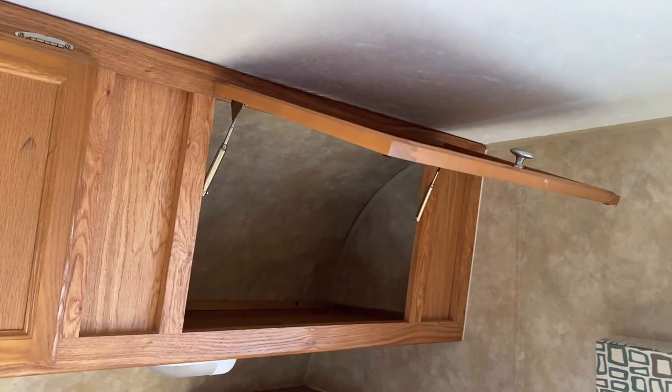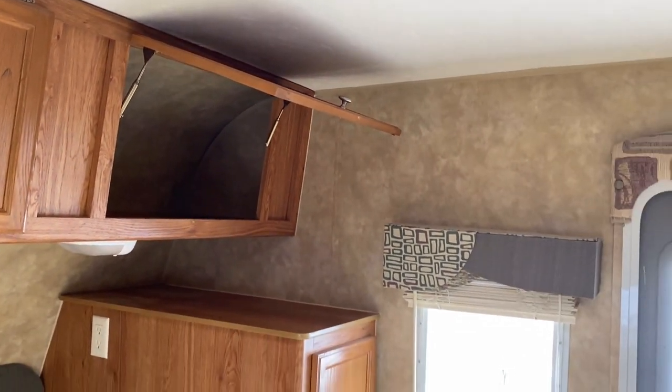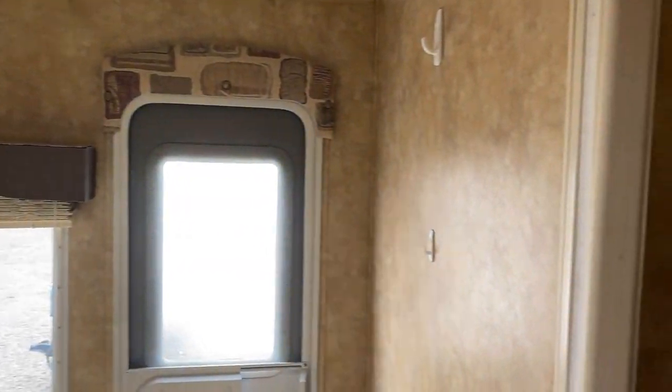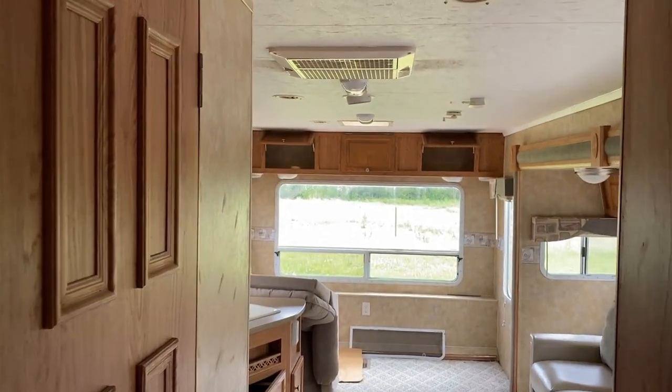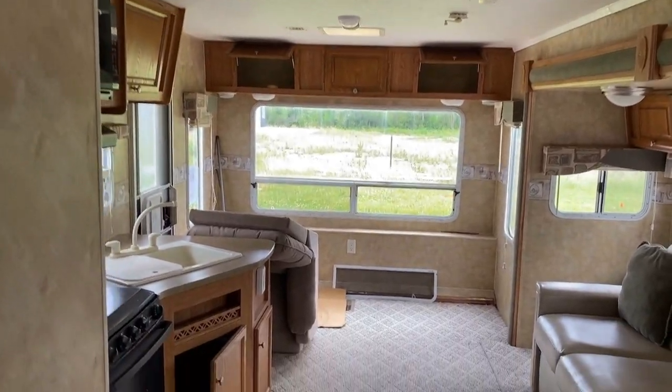Interestingly, the opposite corner and the rear corners all look like they've held very nicely, which is good — it means three out of four corners have done their job pretty well. Something I noticed again: I started asking myself why all of the flooring was redone, which made me think there had been a leak somewhere. And when I look at the rear taillight cap on the RV and some of the trim stuff down here, it makes me think there had been water coming in through the bottom, almost like the rear floor seam.